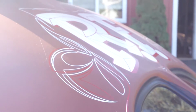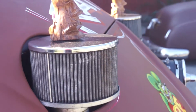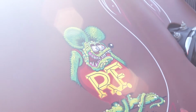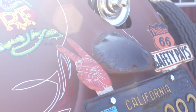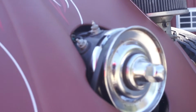Yeah. Then I threw in here a 1972 Porsche engine, just from a 911 with twin Webers. I did pointless ignition, so it doesn't break up at all. And then, did Porsches do generators? I thought that was just a Volkswagen thing. No, the Porsches, every motor has a generator to keep the battery currents going. Yeah, but not alternator. Well, no, they did generators in the old days. Today they have alternators. No cars have a generator anymore. They all have alternators. These are the old school ones.